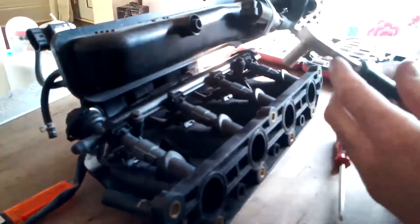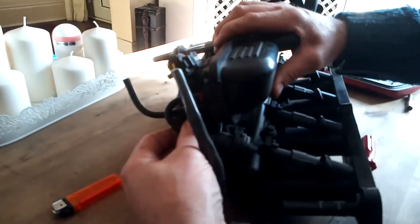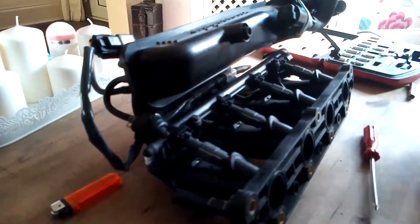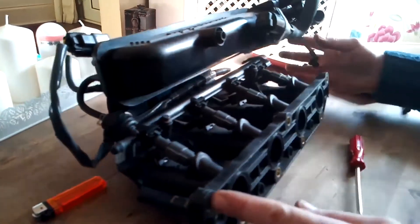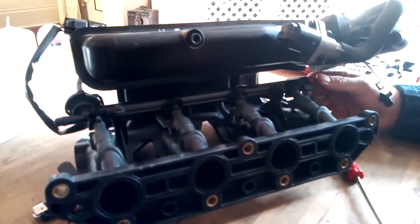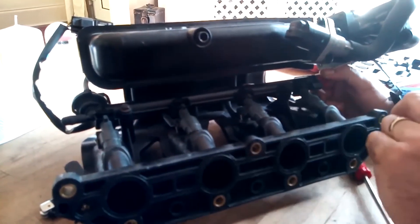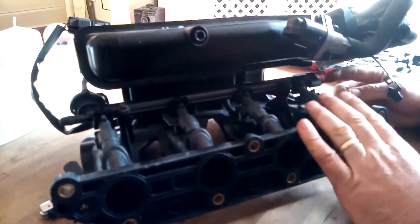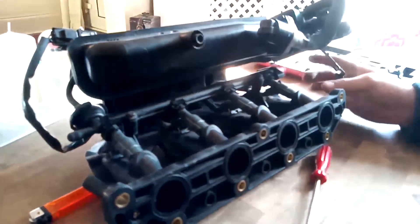You can then get all your wiring, click it back into the right locations, refit all your pipes and your little clips holding the pipes in place. One thing I will say is when you remove the main fuel pipe, make sure the engine's cold so no fuel gets onto a hot exhaust or engine, and also make sure it's depressurized, because these can stay pressurized sometimes. And that's it guys!